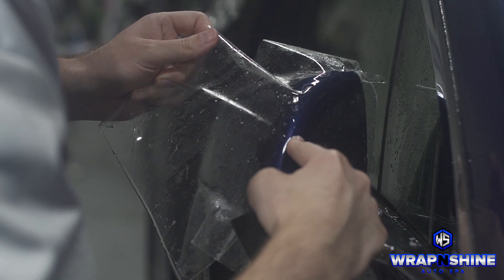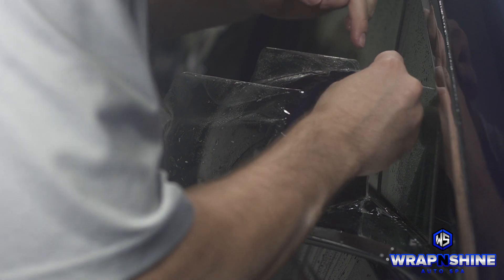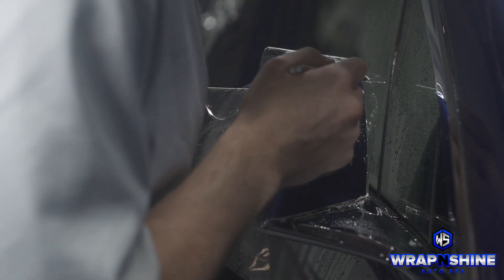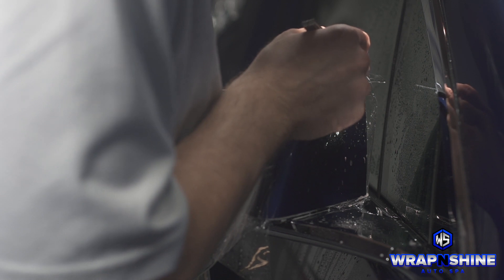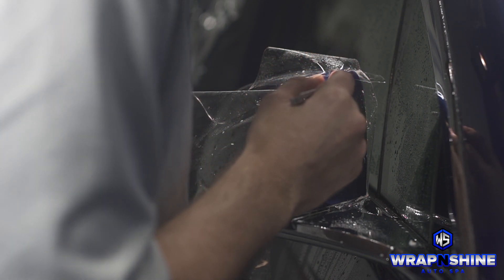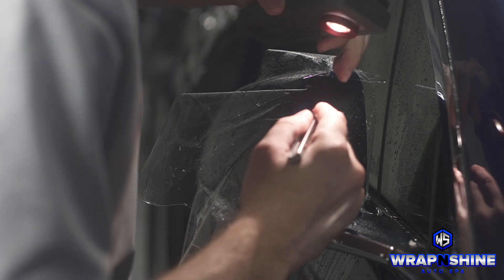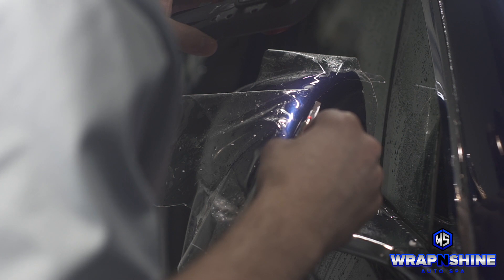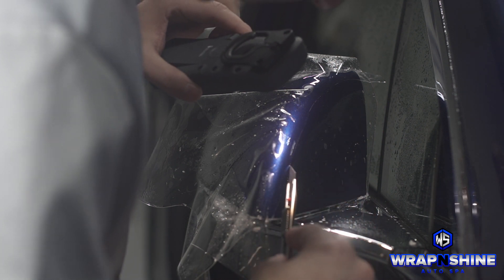My line is back here — it's way back here, you can see a little bit of soap. I did not stretch any of this. It's laying flat here, here, here. I would edge prep this backside and pull a little bit more back there. What I'm going to do is my best to follow this seam all the way down. It does become hard — this is the reason you can pull the mirror off and do this. That may make it easier, but it does become very hard to see exactly where and what you're cutting.